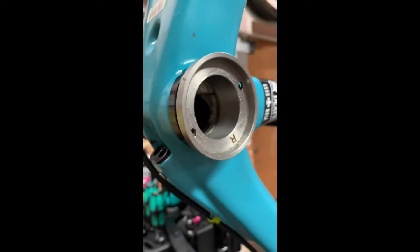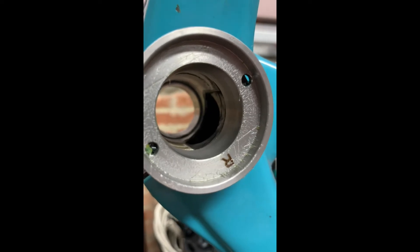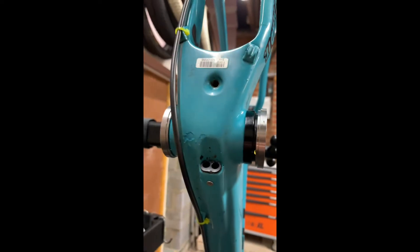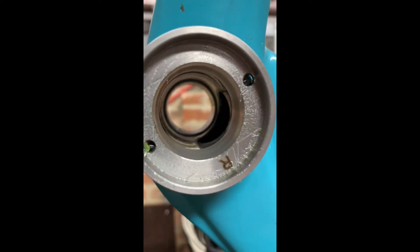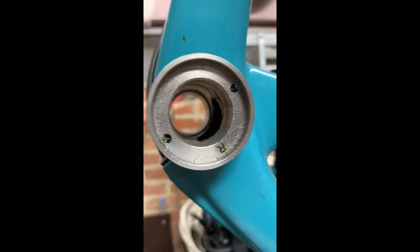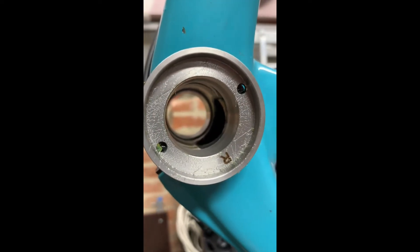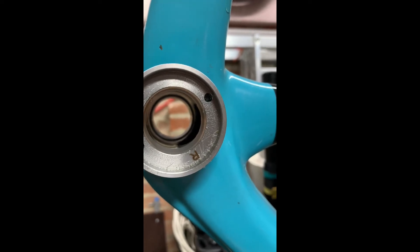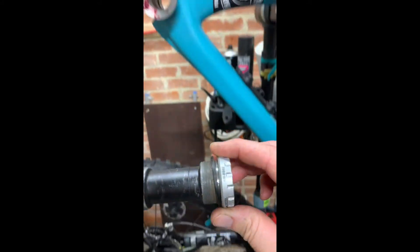Right-hand cup is in, no slippage this time. I'm not sure if that's because the back is exposed — the spacer needed on a 73mm bottom bracket doesn't cover those little holes, so they're open to the elements a little bit. I'll pop a bit of grease in there. Torqued up to 40 newton metres using my arm gauge.